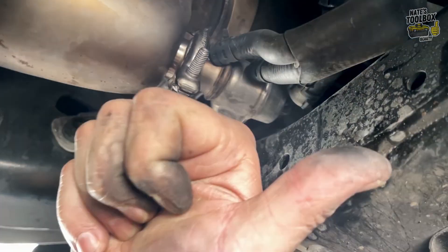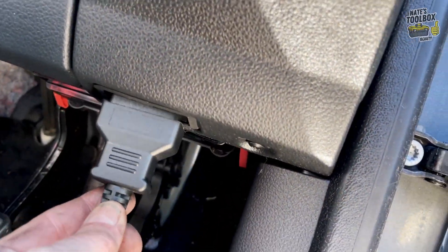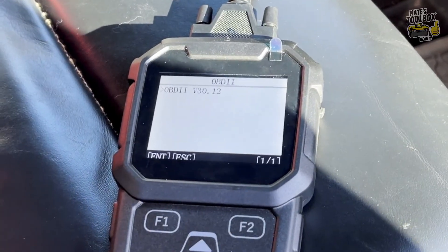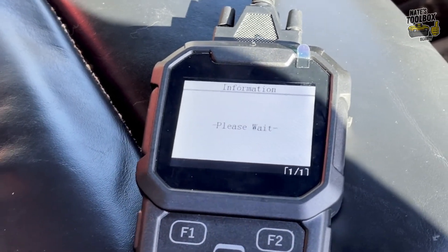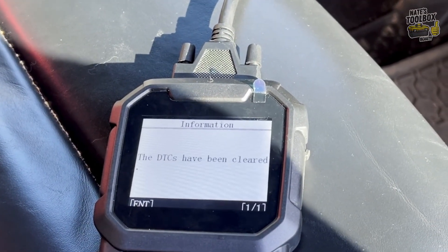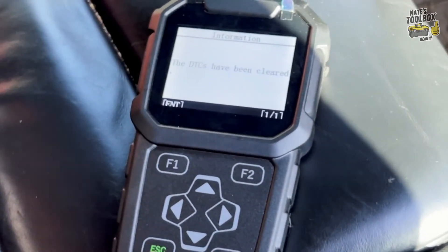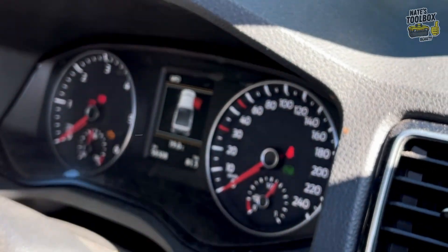Back in the vehicle with the ignition on, we'll go to our OBD2 port tool under the dash. You can get OBD2 tools quite cheaply — there are Bluetooth modules you can plug in and use with a phone app. We'll do an auto scan, select OBD2, read stored codes — we've still got that code there. We'll go back and erase codes. All trouble codes have been cleared. Turn the ignition off, back on again, and confirm no stored codes. We'll go for a drive and hopefully won't get any more AdBlue error codes.